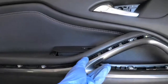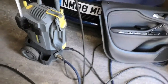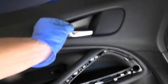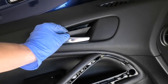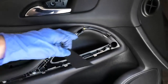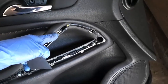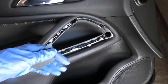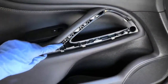So once you remove this, and also this little cover in there — that also pops out. I just use a flathead screwdriver to pop this out and also I had to wedge a flathead screwdriver along here and started slowly prying this off. You could use those plastic trim tools to avoid damaging any of the trim.